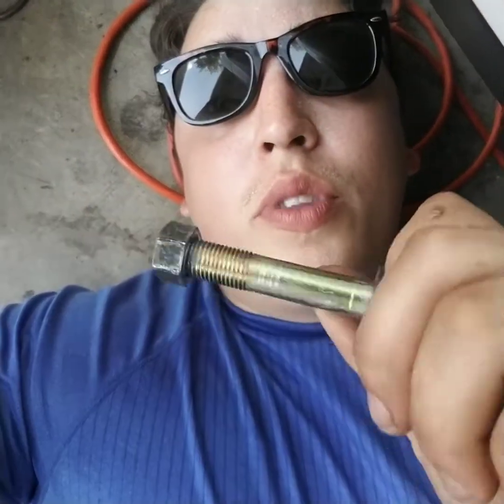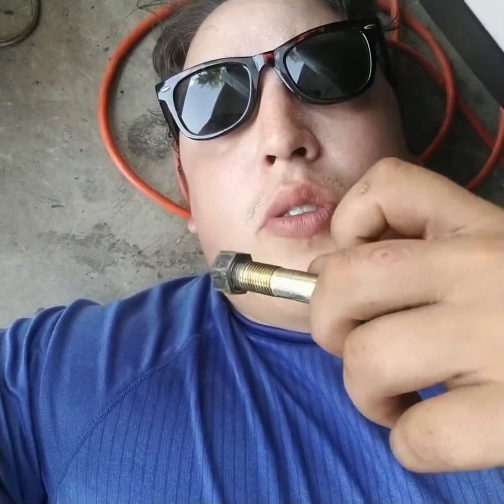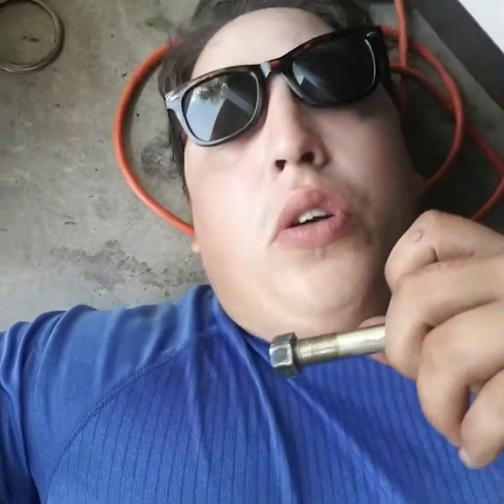In order to roll cars that are too low, you've got to take off some things. On this Supra, this is the bolt that connects the lower control arm to the BC coilover — you drop this in order to get the right angle that you need. Sometimes on other vehicles you have to do the same thing, so there's a tip for you guys.